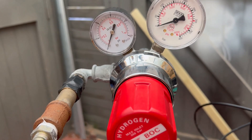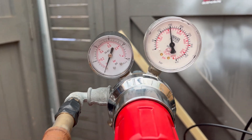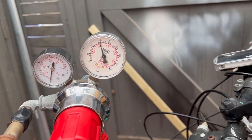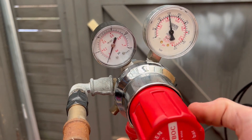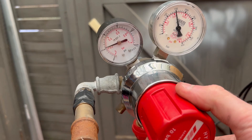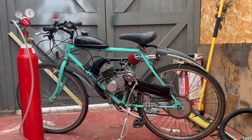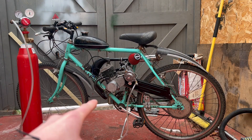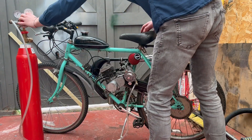I'm just going to turn on the gas bottle now. As you can see, the pressure's gone up to 150 bar — it was 175 but I've been using it for other tests. We're going to set the pressure to 3 PSI just for starting this engine up. We've got the hydrogen gas bottle connected to the two-stroke and I've set the regulator to output 3 PSI of hydrogen gas. This has no oil, so it should be pretty easy to start on hydrogen. Let's give it a go.